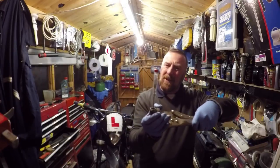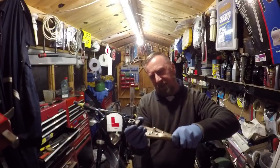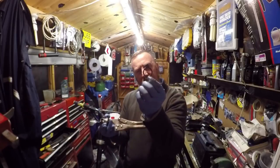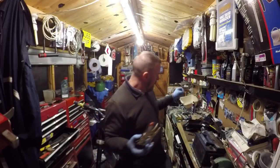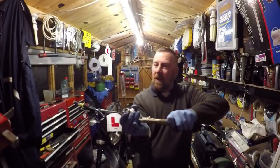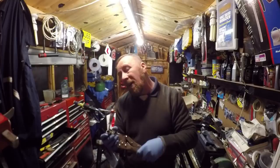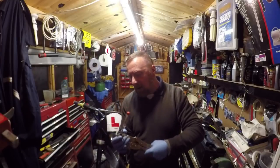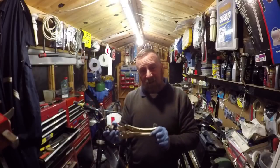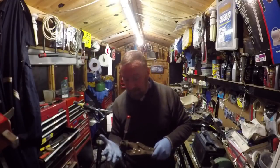Sometimes I just can't let things go — look at that, just completely jammed up in there. The screwdriver is standing in for the cable, but you know what I'm trying to say. On other ones I've had, these have two prongs. This one doesn't — it's not quite round, it's got two flat bits in it. The flat bits go on the inner side of this bit here and the whole thing turns round. So — more WD-40, more turning round. I mean, that's only 20 quid, I know, but it just bugs me when things don't work and I like to make them work. That's a lot of freeing up — I might have to give up on it anyway. Basically, water's got in here, penetrated, rusted it all solid. With a little bit of effort — see, that's quite tight — and it frees up again. I'm going to have a play, and if not, buy another one.